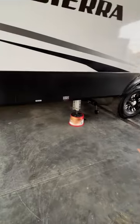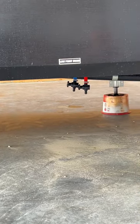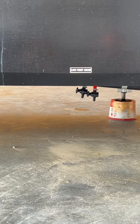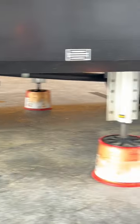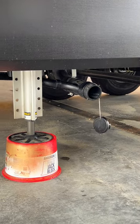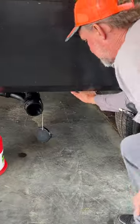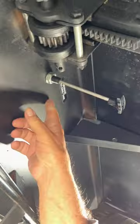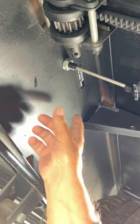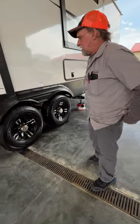We do have our two low water drain points — the blue side is the cold side of the water system, the red is the hot side. We have the termination valve right behind the middle jack. The galley tank handle is up in the front water compartment, but you have a black tank handle just underneath there going up to the frame — it does have a sticker on the side that says 'black tank.' That'll be your half tank in the middle of the trailer and the half bath.